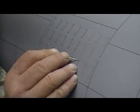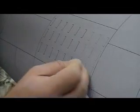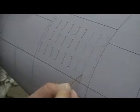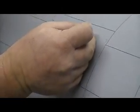These lines are tiny. You gotta be careful when you're painting. But if you're painting so heavy that it's going to fill up these panel lines, you're painting wrong. You know what I mean? Your paint should never be that thick and heavy. That's why body guys that paint cars don't make good airplane painters, because they spray way too much paint. Sure, they can paint a car good, but when it comes to painting an airplane, they squirt too much paint.